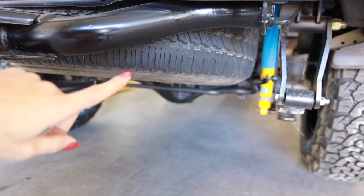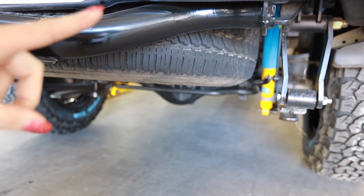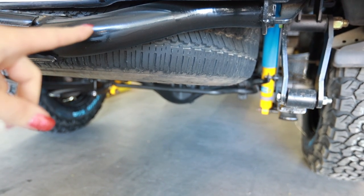I think this is going to lift the truck a little bit too because putting these two tires next to each other — it was like an inch and a half difference in height. Which is weird because this size I think is a 31.7, so maybe the 31/10.5 wasn't a true 31 inches. I know someone's going to ask about the spare tire — no, we did not order a tire and a wheel for that, just because I don't think that size tire will fit under here. So what that means is we're going to have to get a spare tire carrier back bumper with the fold-out spare tire carrier, so that way she has the correct size spare, which means it will need a matching front bumper.